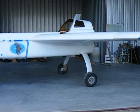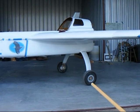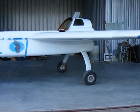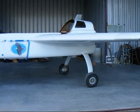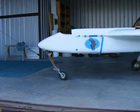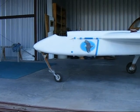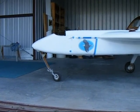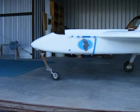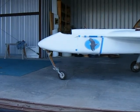Now let's talk about how I raised the frame enough to get the wheels off the ground. Once I could get the wheels free of the ground, I could take the brake calipers loose and take the wheel off, giving me about 3 inches to lower the bow — which would be sufficient to replace those screws. I have the Williamson electric lift in my aircraft, which if overloaded has a slip clutch that can slide, allowing it to come back down. Knowing that was a possibility with the load on the front of the aircraft, I turned that landing gear up and down manually.